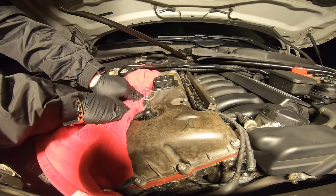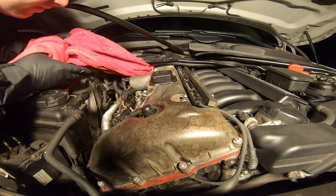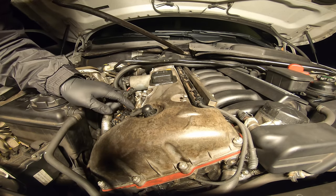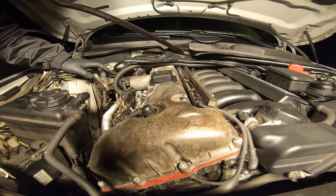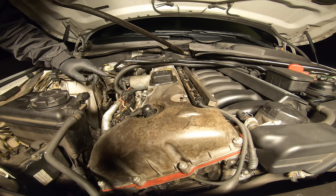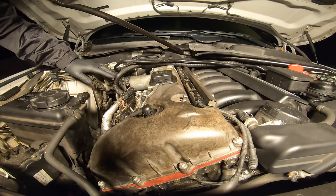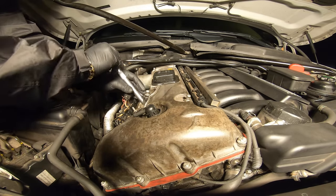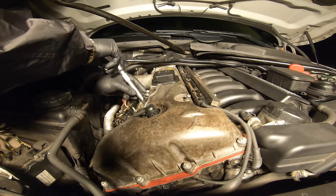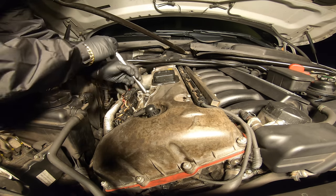As you can see there, I can smell it already — it's been pumping the fuel through and it smells very strong. Now we're going to put the spark plugs back in and refit everything, then get the car back to normal. Crank it over like that first, then reinstall everything. Refitting is the reverse: spark plugs then ignition coils. Before putting the case back on, make sure the car is running fine. I'm just retightening the spark plugs now — hand tighten them down, no need to torque them hard each time.